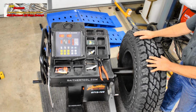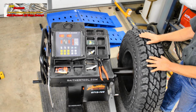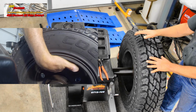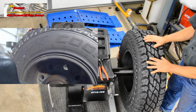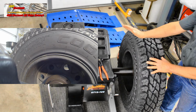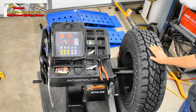And years ago we would have said, well, you're counterbalancing this wheel. If this was a static balance, that would be true. As a dynamic balance, we are trying to counter rotational forces that require an inside and an outside set of weights. If we went to the center with a static balance, we would have the wheel wanting to throw those weights either inboard or outboard. And in that case, we'd end up with an applied shimmy to the tie rod ends on a beam axle Jeep.